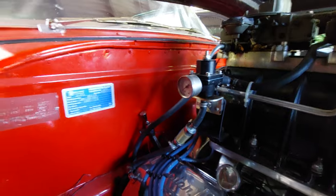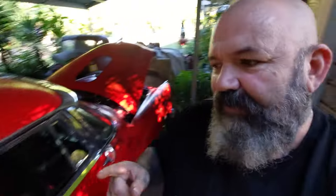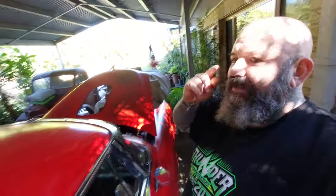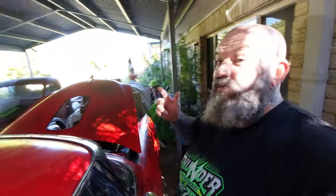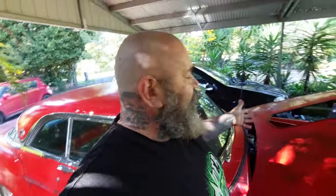Now, I could be correct on my original diagnosis of it being a running out of petrol condition, not a flooding condition. It did flood when we tried to leave the car event, but I did give it a pump accidentally. I probably didn't need to do that. Might have even given it 2 pumps, I don't know, but obviously that was enough to flood it. Whether that was the cause of the flooding condition or we have some other things in there, if we rewind I'll fill you in on the whole story.